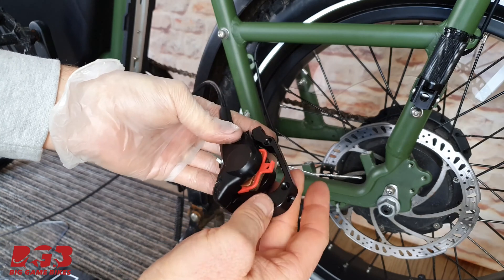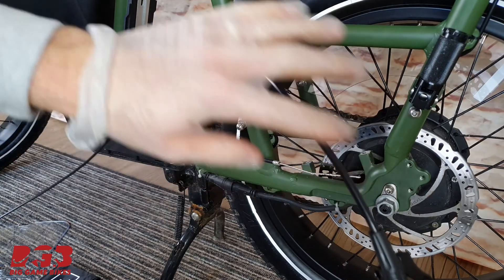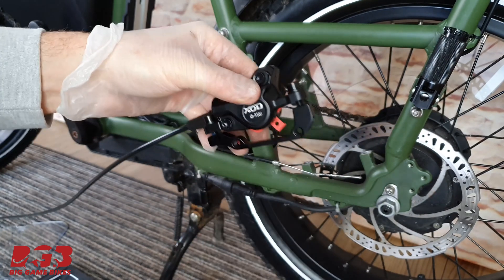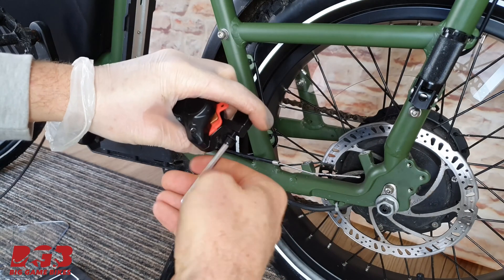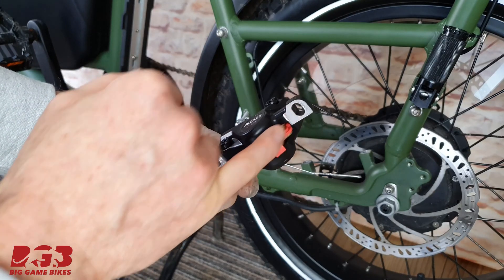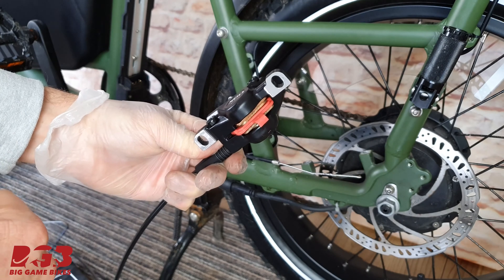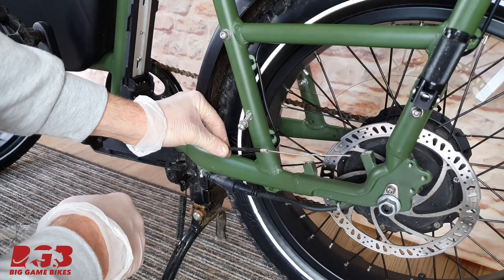This is our new rear hydraulic brake. You'll know the difference between the front and rear by the length of the hose — obviously the long hose goes towards the rear. Your brake does come with this sort of adapter but we don't need that, so just grab your allen key and undo that. Inside the brake is this red spacer — do not remove that until the very last minute. I'll show you when, but for now make sure that stays in place.